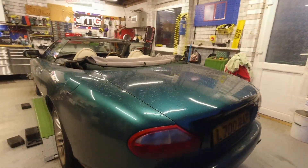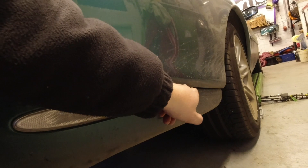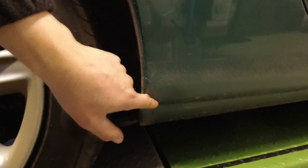Here's my quick guide. Start at the back - they rust here, they rust along here in the gap between the bumper and the bodywork. This area is often very rusty or missing because it's been cut off. This return on the back of the sill - check about an inch in for rust bubbles coming up here.